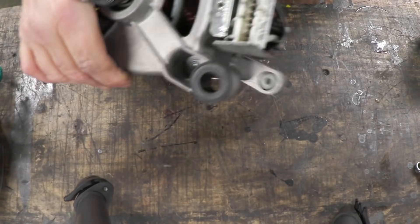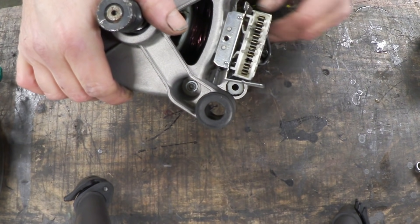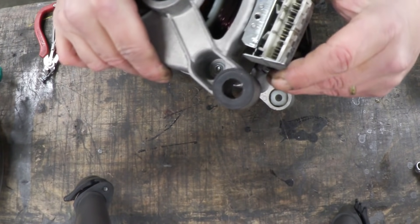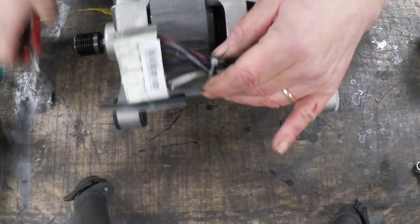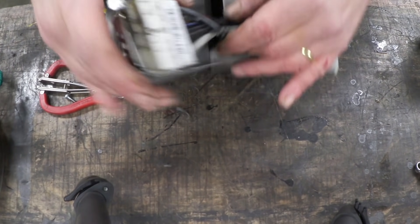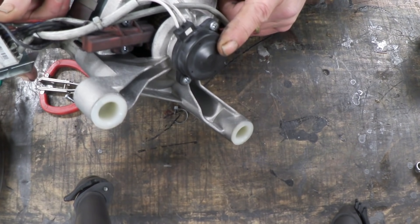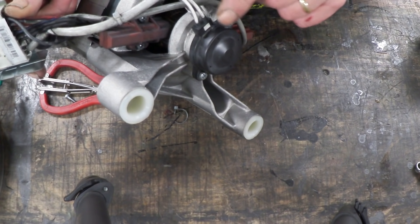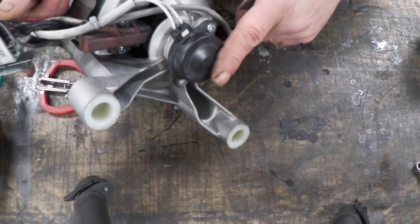Here it is — there's our connector with its 10 pins. Actually there's nine in this and one missing. They vary a little bit but they're more or less all the same. That one was screwed on there and if we undo that screw we can take that off. Now that bit there is actually a tachometer — it's a magnet attached to the shaft. There's a coil in there, two wires coming out, and that's part of the speed control if you're running it on AC.